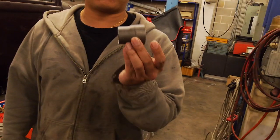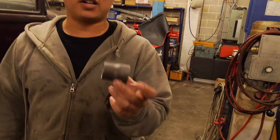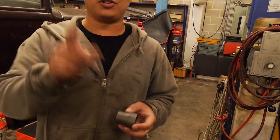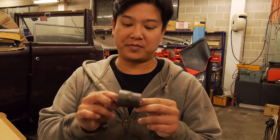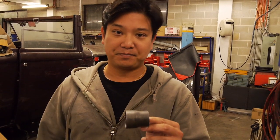They're talking about this getting crushed additionally in service due to heavy loading, whatever. Personally, I can't see how that happens. If you look at the drawing of how it all works, I'll leave that to you as the viewer to have a thought experiment by yourselves on that. What I think probably happens is that because when you assemble a crush spacer, you don't just reef on it as tight as possible. You don't actually put enough load to reseat the bearing that isn't seated properly. Okay? And that probably is what it sort of covers up an earlier fitment mistake.